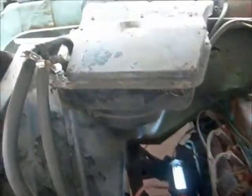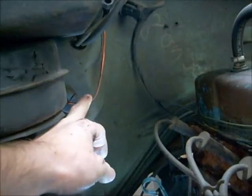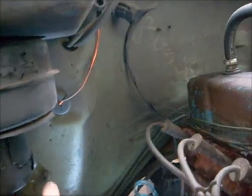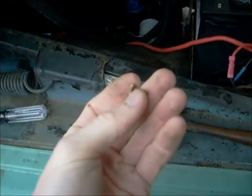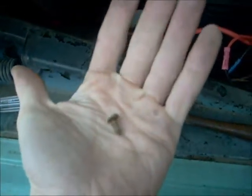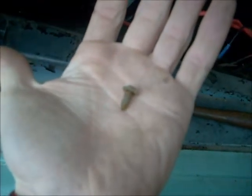Right here in my truck, I've already started and got a little bit done. See, it's right here on the bottom — down under here, this bad boy right here. First thing you have to do is take the power wire loose, which I took up out of the way. It's got a plug back under here in the back where you can't quite see it. There are five Phillips screws holding it on, and I had to take and hit the screwdriver with the ball-peen hammer to get enough force in there to pop them free.